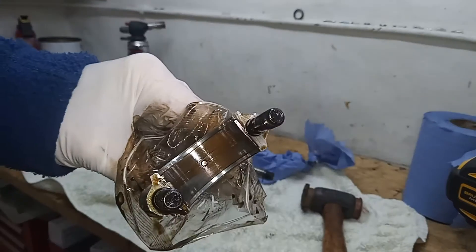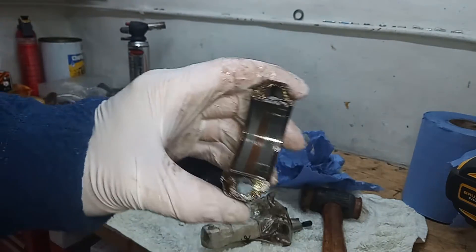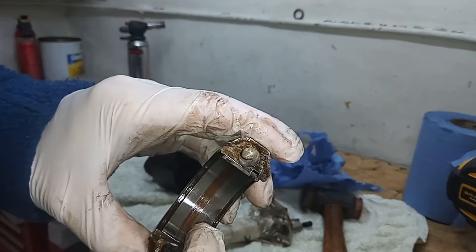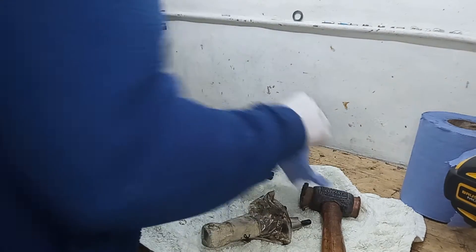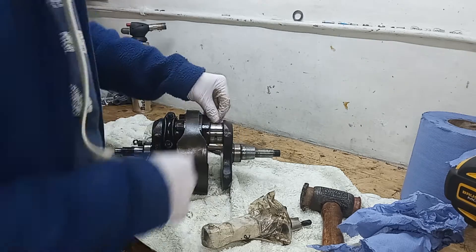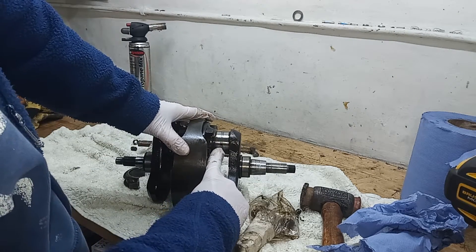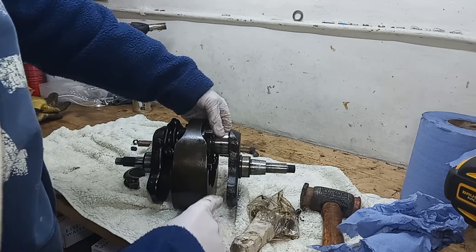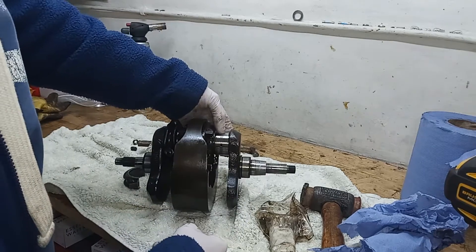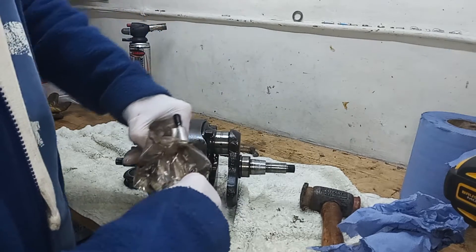It's quite a deep groove, but the shells themselves aren't badly worn - they're worn as you'd expect. On the other side we've got that same groove. That dark mark in the middle is where the oil way will be on the journal. The journal will definitely need honing at least and may need a regrind. What's happened is corrosion has come up from the oil - probably no regular oil changes at some point - crud got in, scored the journals and the bearing shells.